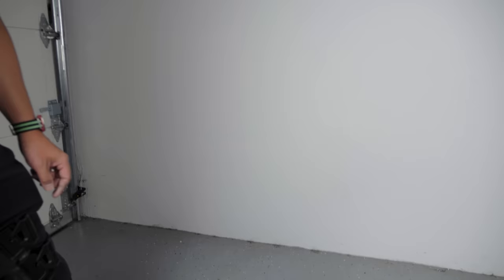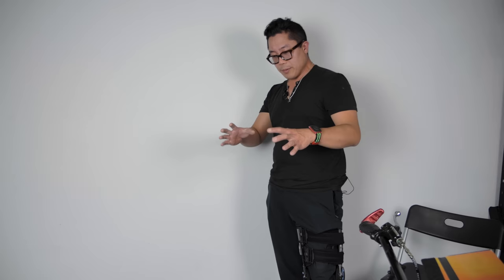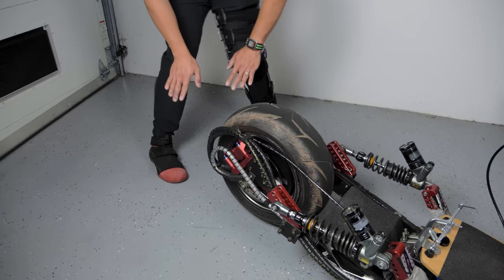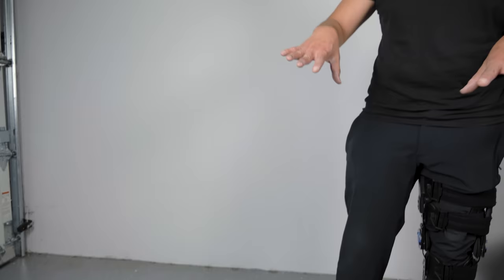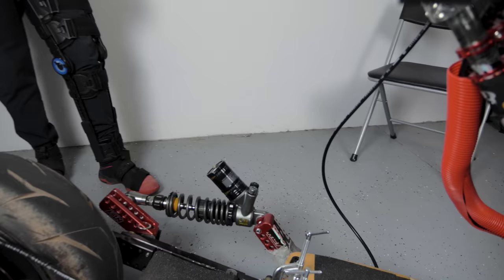This tire is really cool too. You used to have actually a bigger tire. This is actually even a thicker tire but a little bit less tall. The previous one was 13 inch by 4 inch. This one's 12 by 5 inch. I was looking for something with a smaller diameter because the other one was way too top heavy — it always felt like the scooter wanted to tilt out. This 12 by 5 makes it feel like you're actually in snow and you just have this nice gradual carve. When you're going heel-toe, it feels way more predictable. The wider width also really made a difference with the angle you can lean over. The tread pattern just looks sick too — it's an amazing tire.